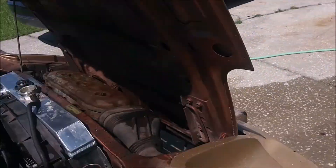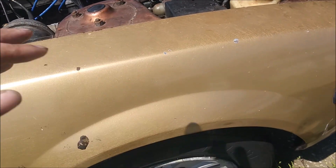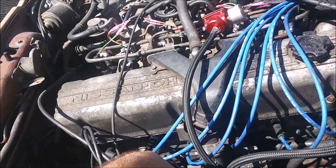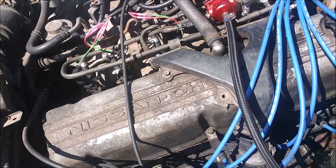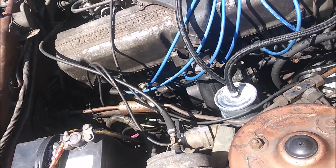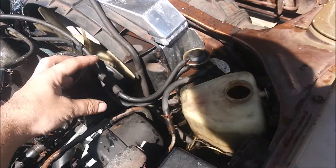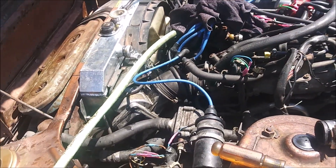After this I'll push the car back down to the most level spot and start stripping it down. I'll pull the spark plugs, a couple sensors, the fuel rail — don't have to pull it but I will for clearance — and I'm going to have to pull the power steering pump off and just set it to the side. That's pretty much how that's going to start.